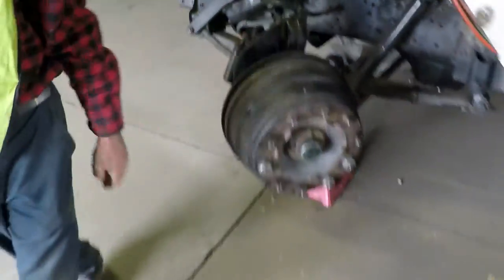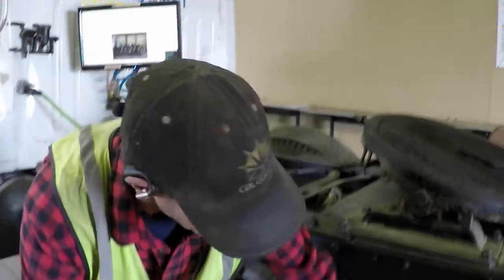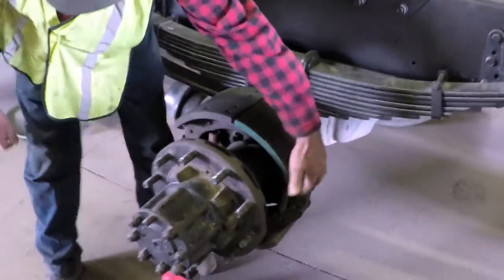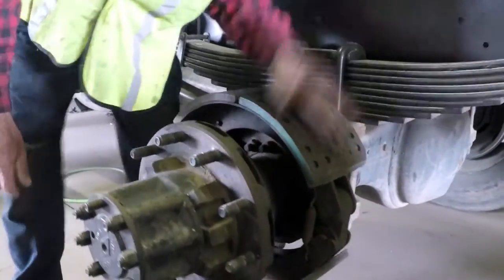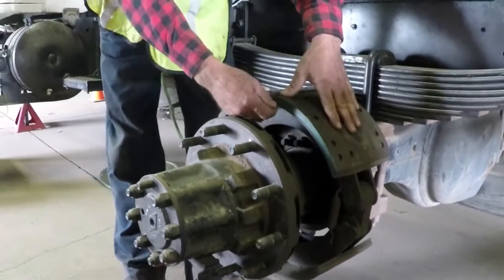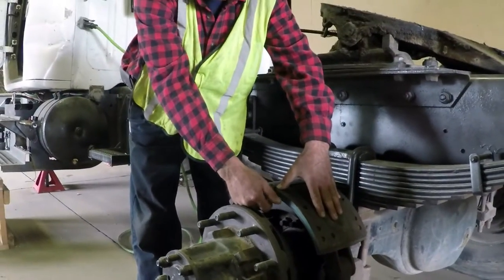From here, let's go back and look at the actual braking shoes. General condition: they're not bent, broken, or cracked, securely mounted. When these springs mount, they bounce around inside the drum. Additional factors: not dangerously thin, with a minimum quarter inch of thickness — you're talking about this material here.